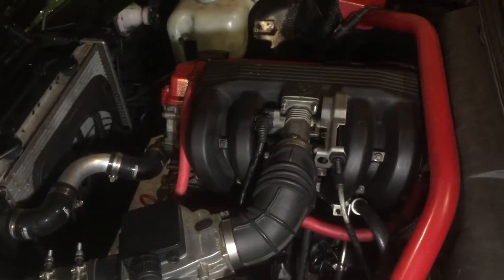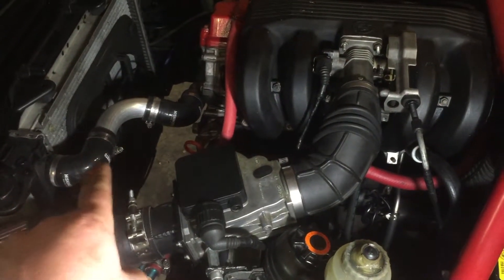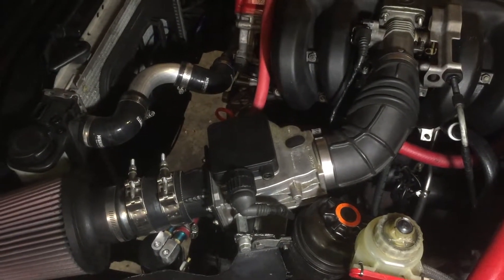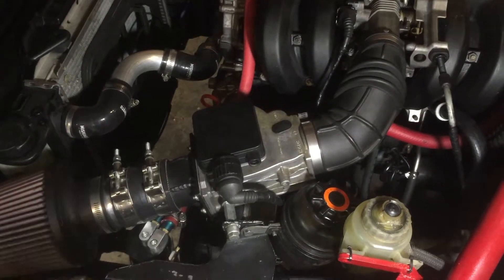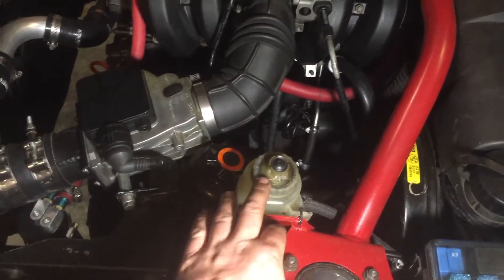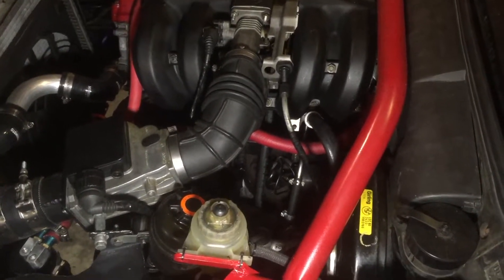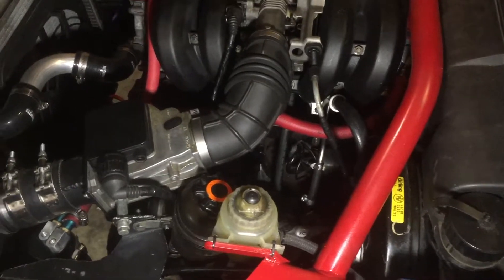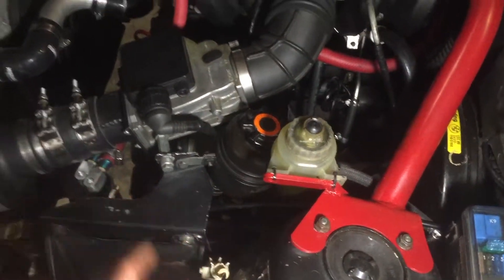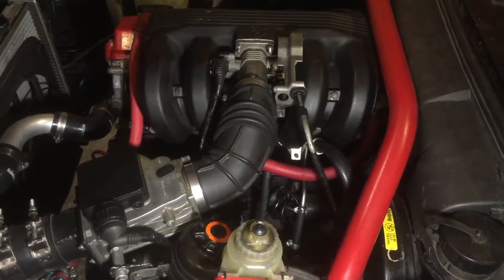Let's take a look in the car. So I just want to do an overview of what I've done so far. Right here we have a custom radiator tube that will hopefully clear the supercharger belt. I moved the power steering belt over so the supercharger belt can run off the crank. We moved the brake master reservoir here so it won't interfere with the supercharger and the inlet tube. The power steering reservoir is also moved — hopefully that'll be fine. Other than that, what's left is the inlet tube, which you just saw the plans for.